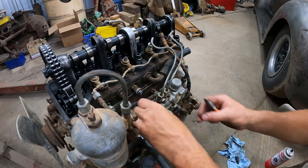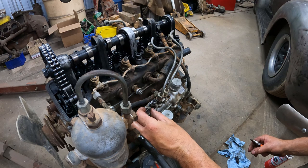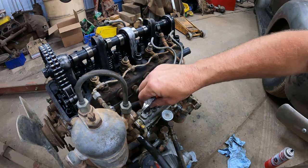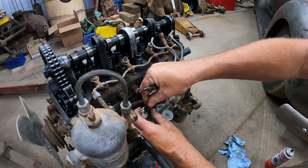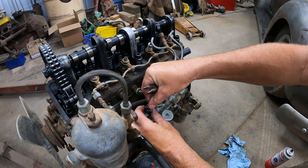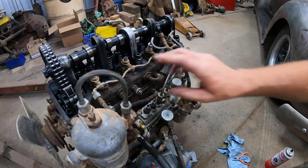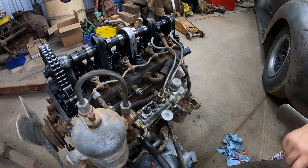not good. But since this engine comes apart, put the copper ring on, put the spring on. It's a little finicky, but don't try to force it. Try that it settles on its own, gets into position. It's when you try too many things. Come on. So should go easy in. Take your time, and then by the manual, torque it, don't over tighten it, you don't want to damage the pump body.